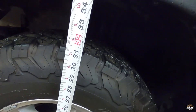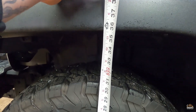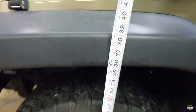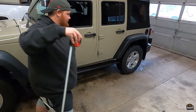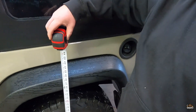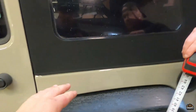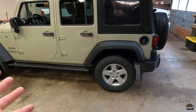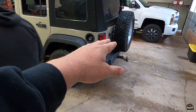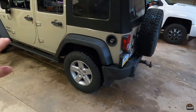The top of our front fender flare is looking to be about 35 and a half inches. The back is about 36, so the rear end is a little bit higher. That's typical for trucks — you want the back end higher so that when you have a load it squats down and rides level.